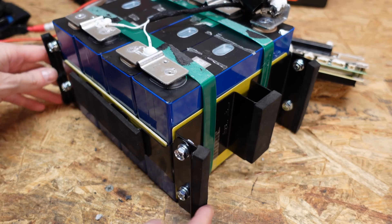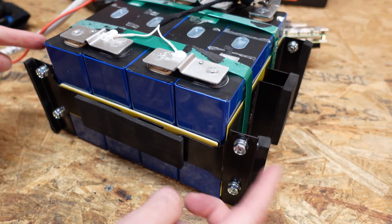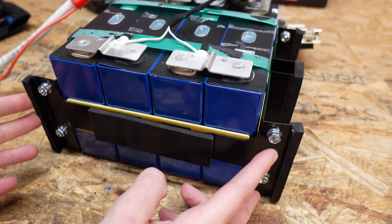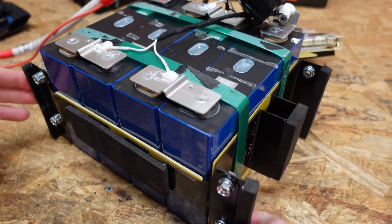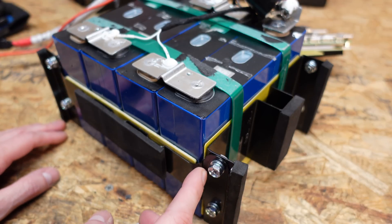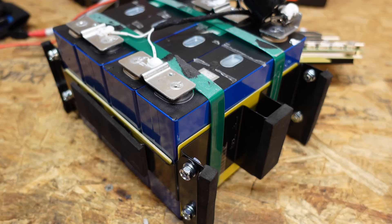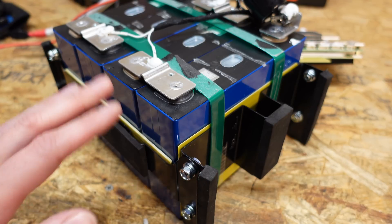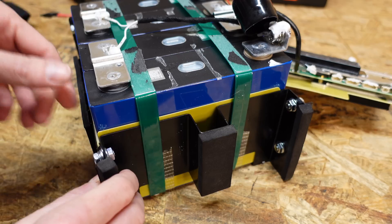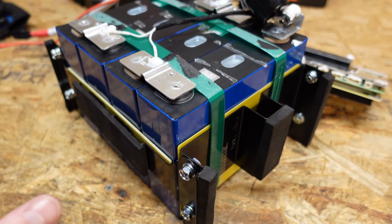Looking at the structure of the battery pack, they've built a steel frame that goes all the way around, built in four pieces — two end pieces and two long side pieces — held together with bolts at each corner. What I like most about this design is that they've fixed a prior issue where the clamping mechanism was squeezing the corner of the cells. Now there's insulated protection between the metal pieces and the battery cell, so zero contact between the metal frame and the pack. And the frame is not clamped tightly — it fixes cells in place without exerting compression on them.